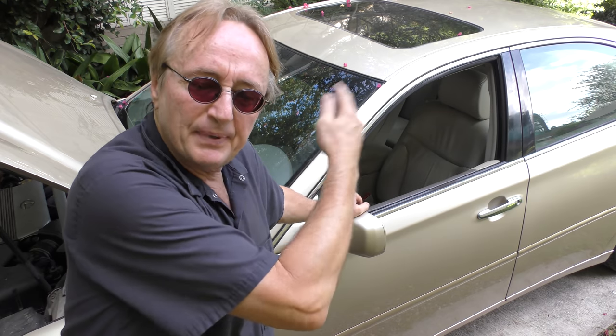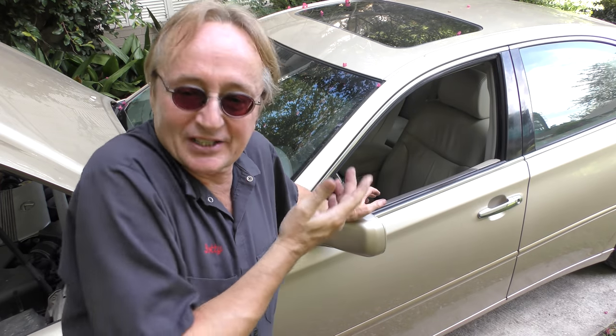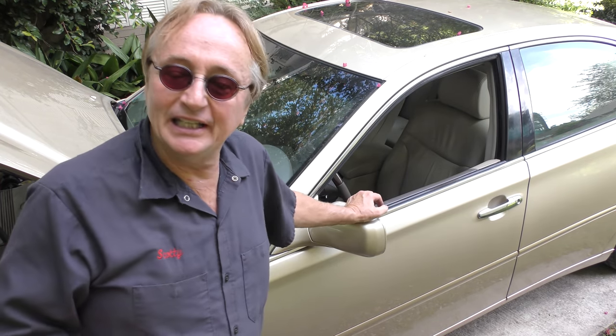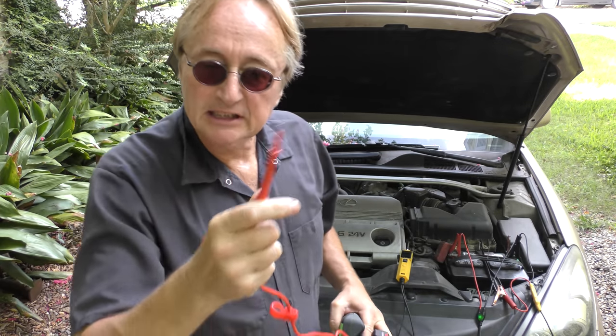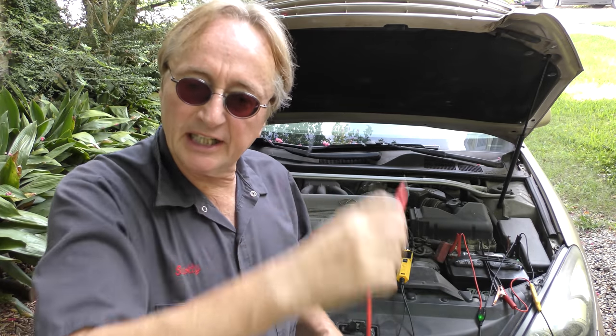So of course you need to know where the computer is. Well, in this case, it's up in the dash. You got to pull the glove box off. And I'm not going to show you it because the only reason this one came on is because I unplugged it to make the code pop. There's actually nothing wrong with this. It's a Lexus. It doesn't matter that it's 19 years old. I have never ever had a problem with the ECT sensor on any Lexuses, but I'm using it as an example. So once you find the computer and the feed wire, you plug this in and give it 5 volts,